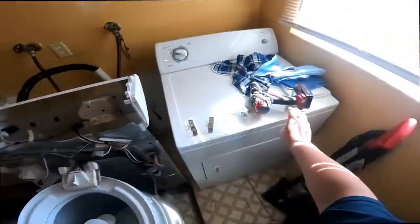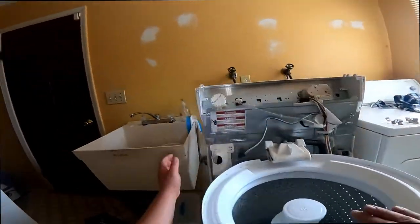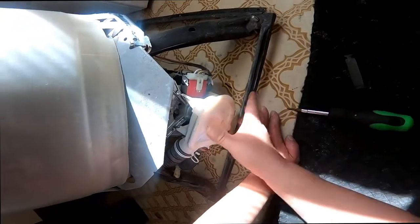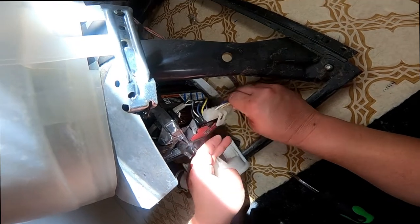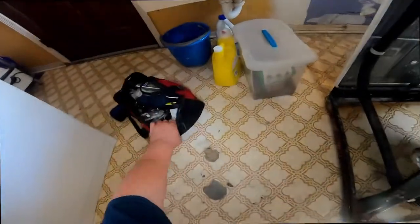Now we're going to put a piece of cloth down to work more comfortably. Then we're going to pull this panel towards the front and lean the washer back after we remove these clamps holding the drain pump. Those clamps — you only need a screwdriver or pliers to pry them out. They go inside those holes, you turn them clockwise and it holds in place. Then remove the harness attached to the motor. Once you get that wire loose, the next thing is to remove the clamps from the motor.